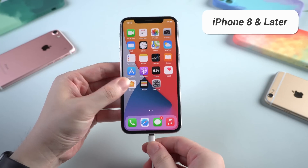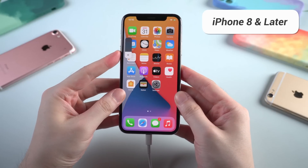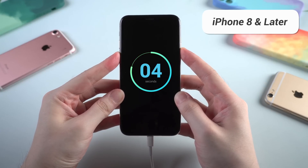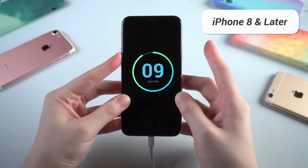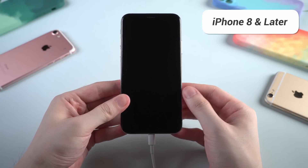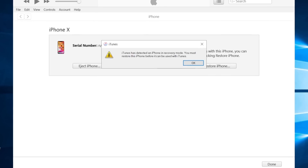The last one is iPhone 8 and later — here I take iPhone 10. Also connected to the computer. Press volume up, then volume down, then hold the side button till the screen goes black. Press the volume down and side button at the same time for 5 seconds, then release the side button while keeping the volume down held. Your iPhone will show a completely black screen, and when you see the pop-up window showing info like this, that means your iPhone has entered DFU mode successfully.